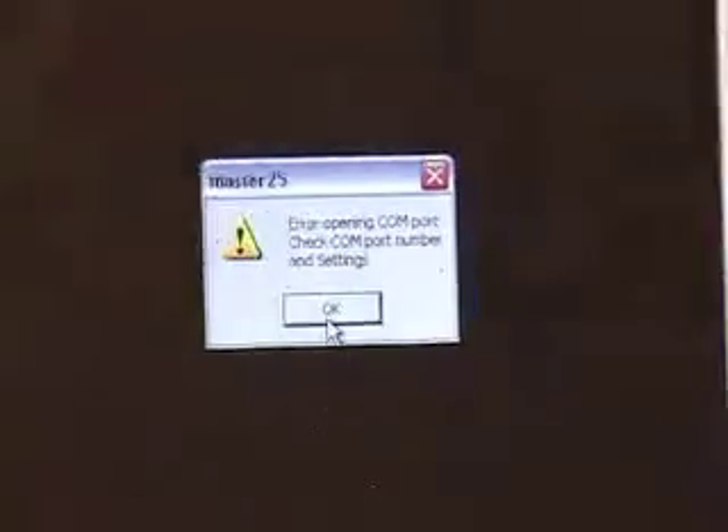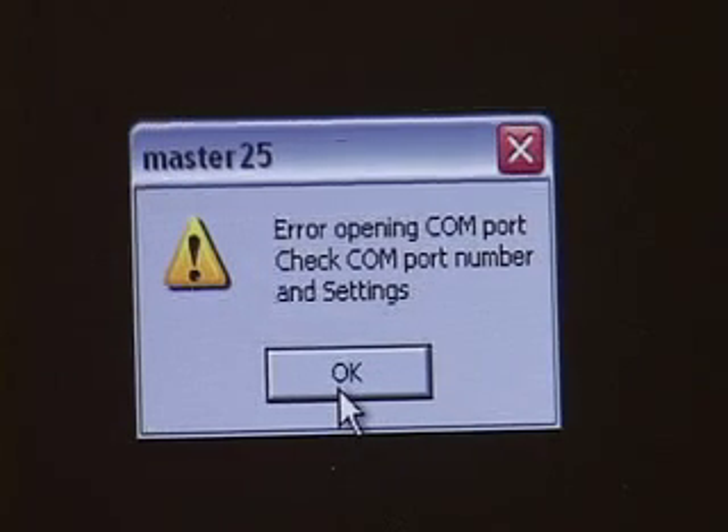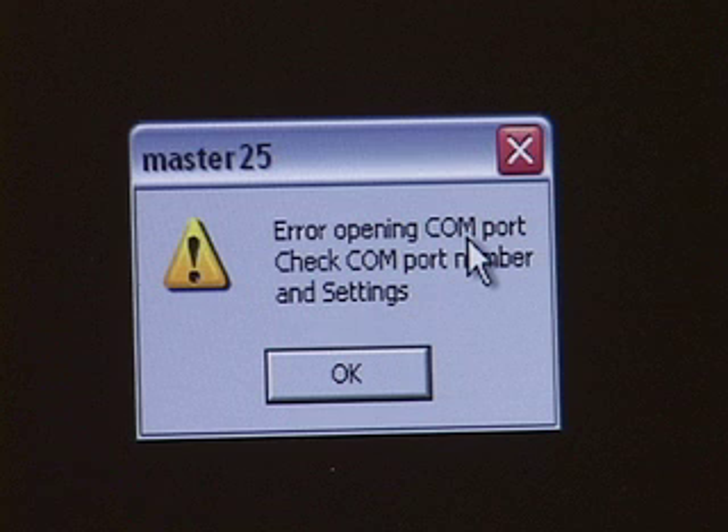Again, this is not a battery issue — this is a Comport problem. Another reason you may see this particular error is if you have a PDA or like a Palm Pilot. Palm Pilots tend to be very aggressive holding Comports. So if you sync on the particular PC that you're using your electroencephalogram on, Palm will hold on to a Comport — even though you've used it before with the Brain Master, you'll try to communicate and get Error Opening Comport because it's being blocked by the Palm software. If that happens, go down to your taskbar, right-click on your HotSync Manager, and disable the connection to the Comport. It's different in all of the different PDA software, so you may need to use your manual for your PDA to figure out how to do that. For the most part, it is simply down to the taskbar, right-click on the icon for the Palm software, and disable it from there.